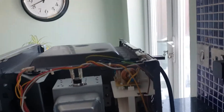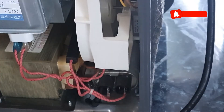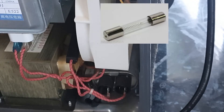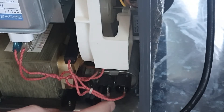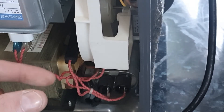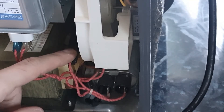The two main issues are down here. The first problem is in this sheath here — this plastic case contains a fuse. Normally it's a glass fuse, so you can just look through it and the wire inside might be broken. In that case, the first fix is to replace the fuse. They're easy to get hold of — about one pound from eBay. Mine here I've already had out, so I won't get it out again. It's just clipped on with a normal push-clip. In this case it's just a thin piece of wire acting as a fuse, with no glass casing around it.